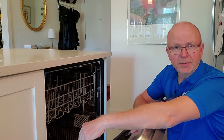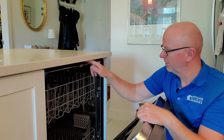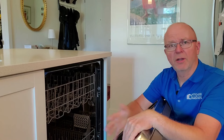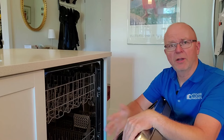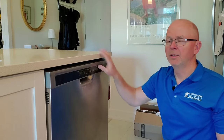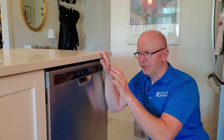So lift it up and make sure it's sitting correctly. I've even seen some installers put a piece of wood or a strip of whatever they found — one person even used packaging material from the dishwasher's own box — just to squeeze something in up there to put a screw through. That tells me that installer really did not know how to install a dishwasher correctly. Don't let your installer or yourself do it the wrong way. Lift it up so it will be nicely aligned with the cabinet next to it. This is particularly important if you have a panel on the front of your dishwasher, because then you will definitely notice it's not in line with the adjacent cabinet.